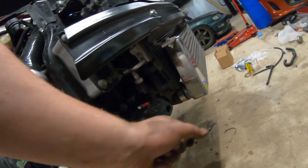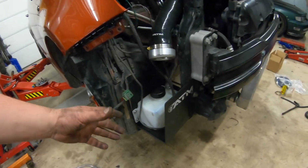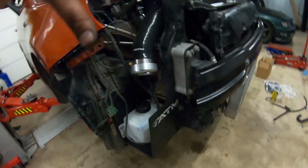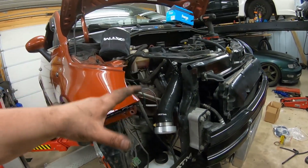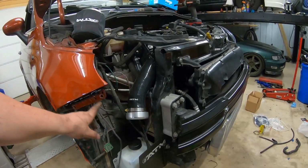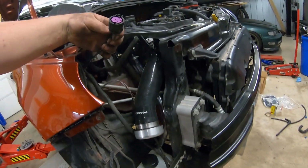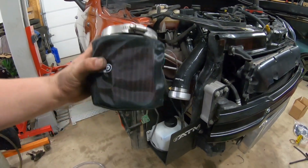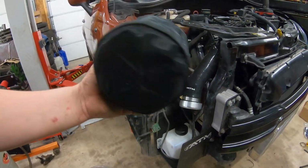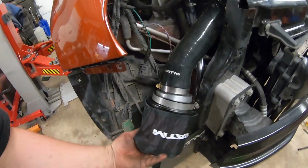So you mount this actually to the factory bumper supports, two bolts right here. Those are 14 millimeters, if you were wondering. So you just need a 10 and a 14. The easiest way, I was trying to do it without pulling the headlight, and it was a super pain, but the headlight is literally 110, 110, 110, and you just pop the headlight out, and it is literally only one clip. Another cool thing this kit comes with, which I haven't seen many other kits, is the K&N with the water sock, and it actually fits very well